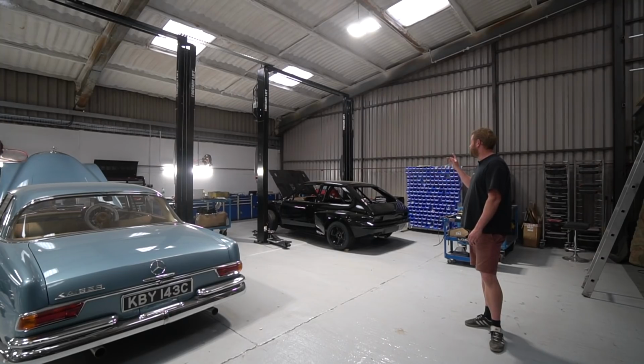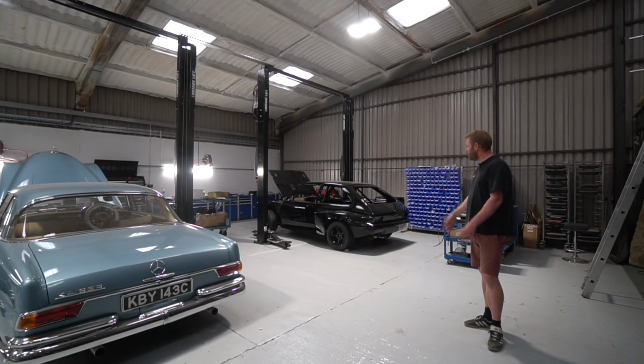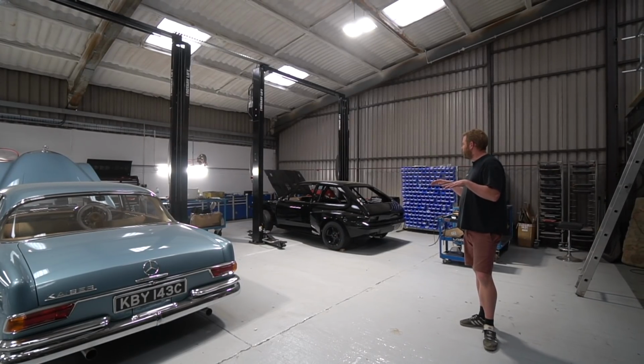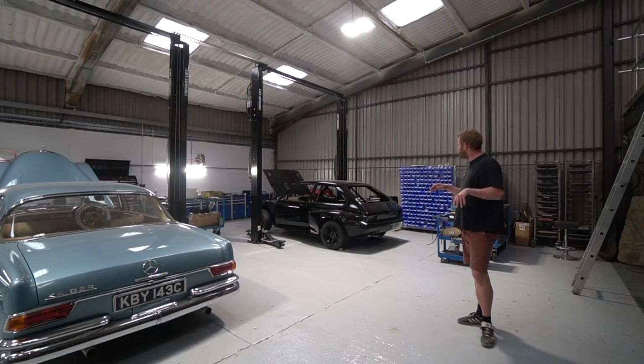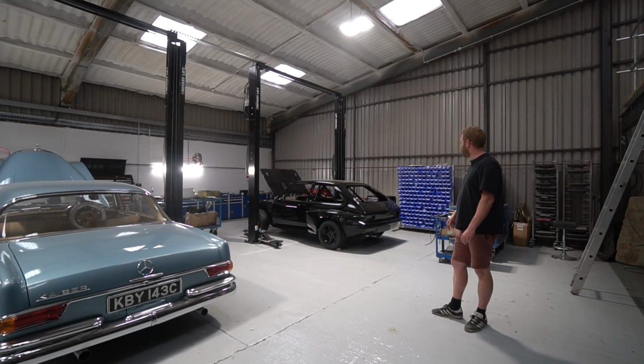So that now needs the straps making to strap it down. We've trial fitted it in there, fits a treat. It's essentially a rectangular tank with a little notch out each side underneath. On one side that clears the tunnel that's in for the exhaust silencer, and on the other side it just comes up to clear a pressing in the original bit of floor.